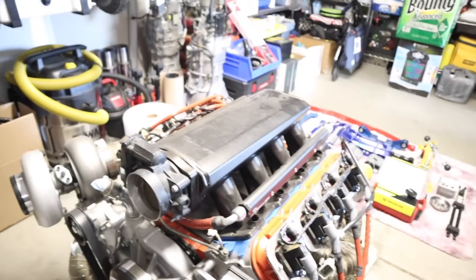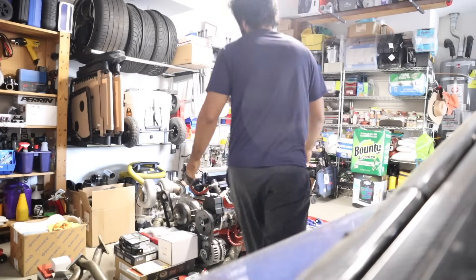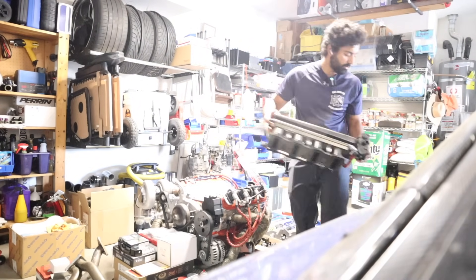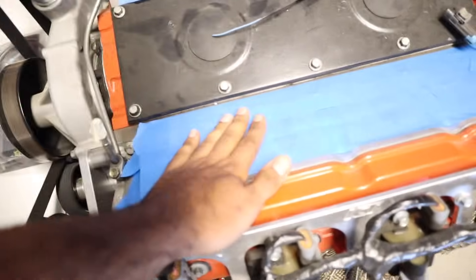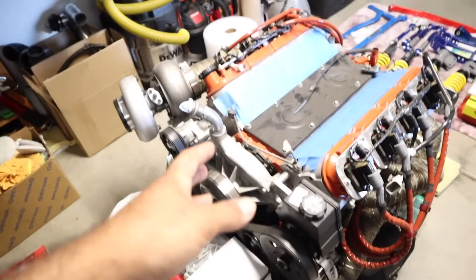So I build my own stuff, and we went ahead and built one that we'll also offer at Trigger Spec. But first, before anything, we gotta take our Holley Sniper intake manifold off. Now that we have that off, we have what we call the valley exposed. We have a Gen 3, and our knock sensors are right there, so I'll tape those off so nothing gets in. We're talking about this whole assembly, this line going across, and those corners right there — I'll show you guys what I've developed and what we're going to replace it with, and how to install it.